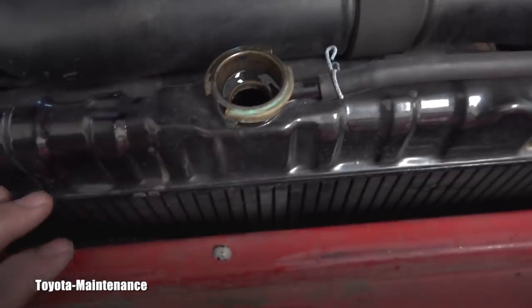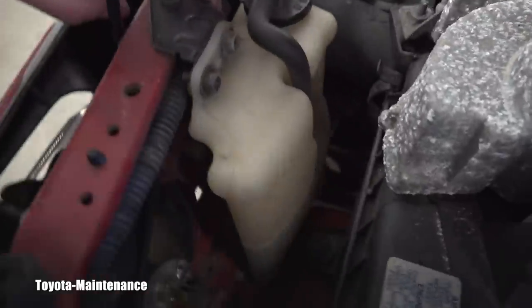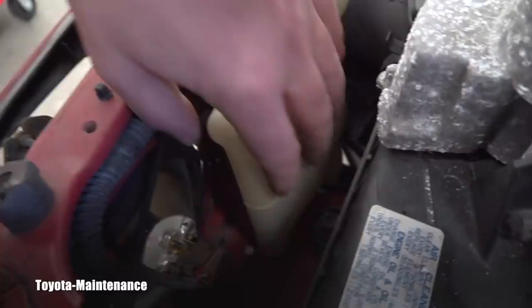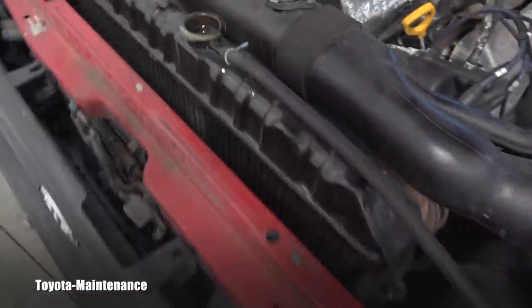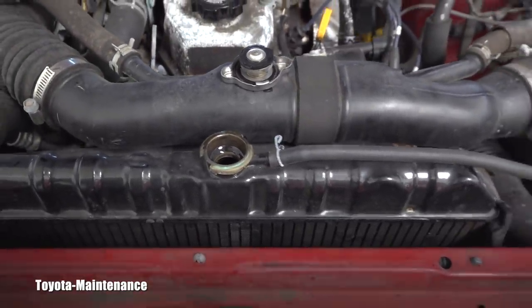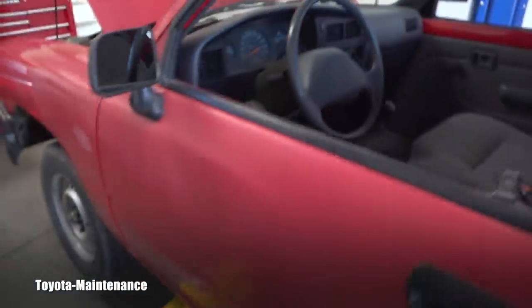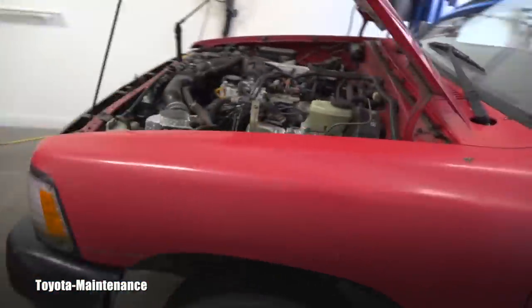When I opened it, there was one and a half gallons of coolant missing — the radiator was almost empty, and the expansion tank was completely empty. Right now I added just water for testing purposes, filled it up, and ran it. It was blowing perfectly hot air inside, and because of that — using it when it was full — I found the problem.